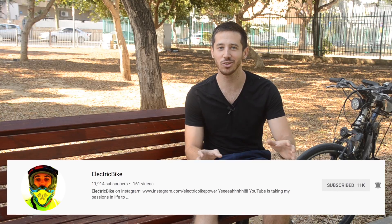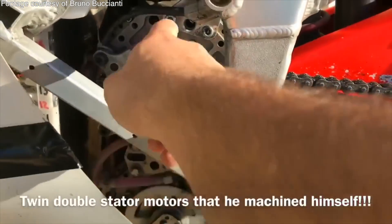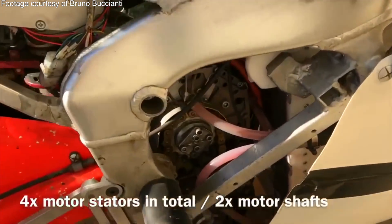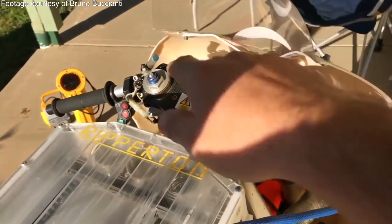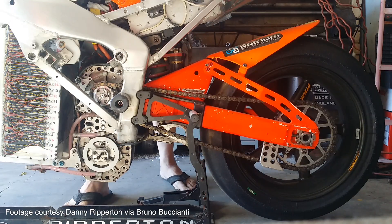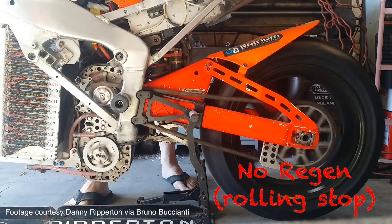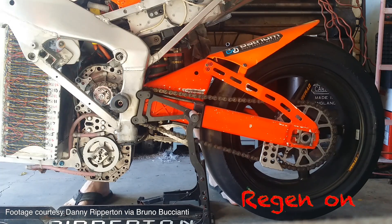Now here's something really different. You guys know Bruno's Electric Bike channel here on YouTube — if not, you should definitely go subscribe because he's got some awesome videos. If you are a subscriber, you probably remember his recent video on Danny Ripperton's crazy powerful 210-kilowatt electric Yamaha R1 racing bike. This bike uses two double-stator motors — effectively like four motors set up in a mid-drive configuration, hard connected to the rear wheel like in a standard motorcycle setup. This allows him to use regenerative braking in a mid-drive setup, which is incredibly powerful. In fact, he doesn't even use mechanical brakes in the rear — he only uses regenerative braking for rear wheel braking. Check out this demonstration where first we can see how the wheel decelerates just by rolling to a stop, and then how it decelerates when he engages regenerative braking. That's really impressive.